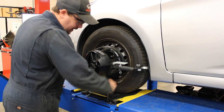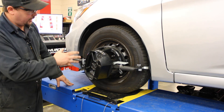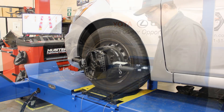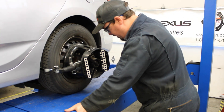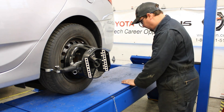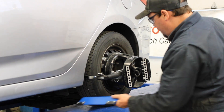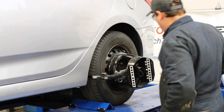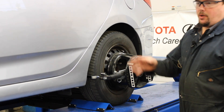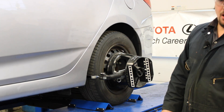So with all four heads mounted up, we're going to take out these pins and just jounce the suspension a little bit, getting it so that the suspension is at that level spot where it'd be when the car is actually driving down the road. We're also going to remove the pins from the rear skid plates and do the same thing on the other side. We're going to take our wheel chocks and go to the driver's side rear wheel and put one in the front and one in the back, because we are about to take off the e-brake.